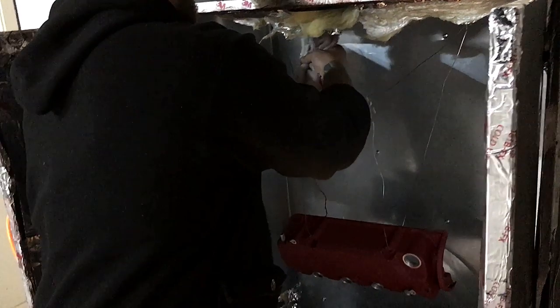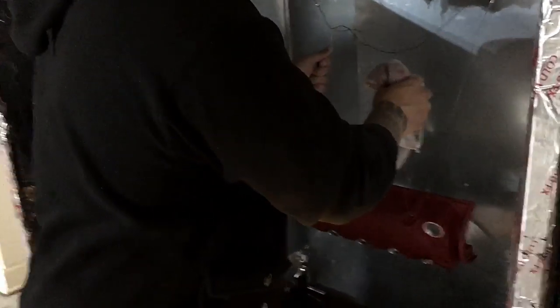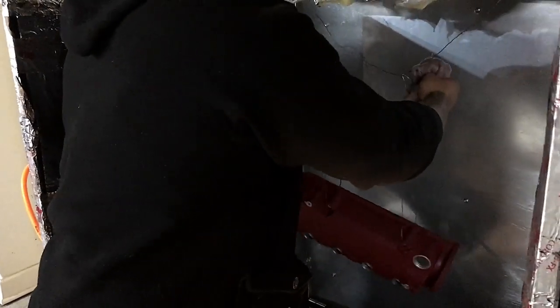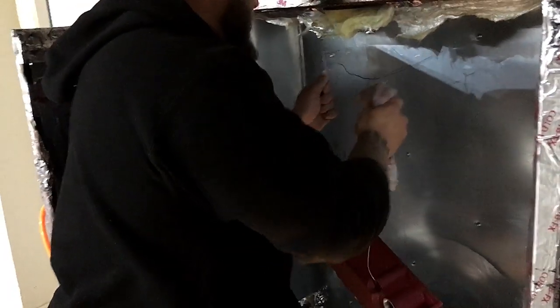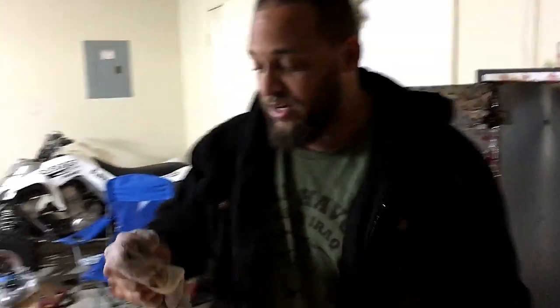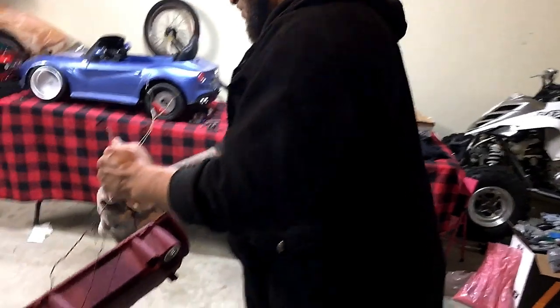All right, guys, it's coming out of the oven. But it is fully cured. 400 degrees, 12 minutes. Now it is fully cured, so it's not like when you first coated it and couldn't touch it. You could literally bang this thing around and it'll be just fine. We're just not going to do that because we take care of our things, kind of. So let's just set this right here.